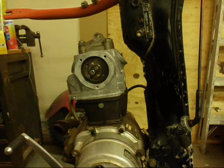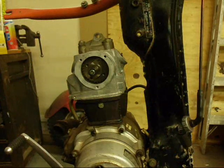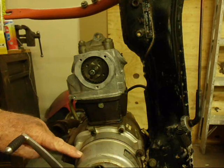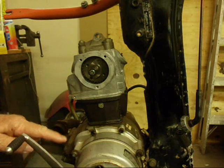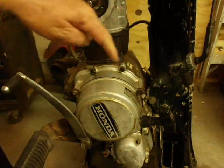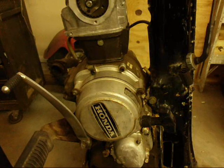Now there's another timing mark for the piston when it's at top dead center, and that's the one I had a heck of a time finding. I looked all over the documentation. It seemed like they were trying to tell us there's an inspection hole on the top here, but that turns out to be for the newer ATC 110s. To get to the F and T marks for the timing, you need to take the starter off, and under that starter there's a starter cage — then you'll see the marks. To get the starter off, there's three bolts: one here, one here, and one here right in the bottom, which we can't see from this angle. So we'll take those off and that'll expose the next part that needs to be taken off.